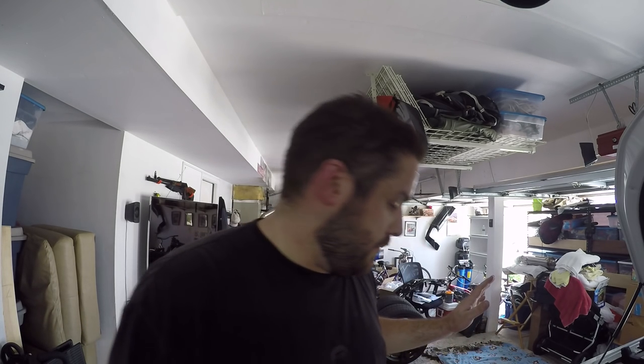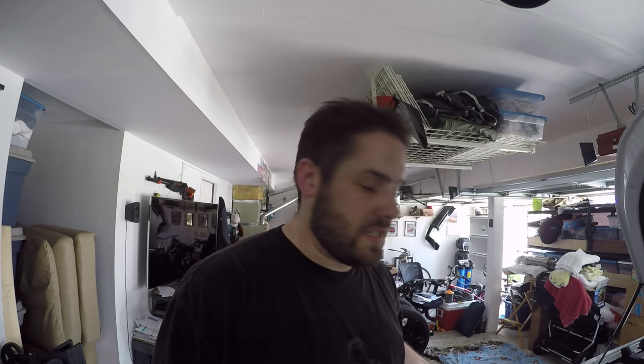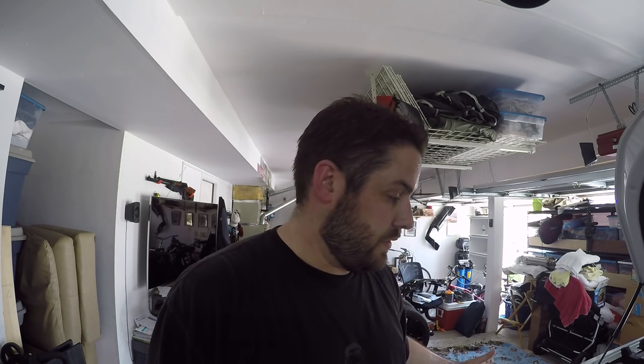So not too hard. How many bolts was that? So there's 13 Torx 15 size screws on the passenger side that need to be removed that I've run into so far. I'm going to do a triple check once I get this other side undone. And then there's the six up top plus the two tree clips. And then I'm going to go do the 13 screws on the driver's side now to hopefully have loosened the whole front end. There's probably some screws on the bottom I haven't gotten to yet, but we'll get there.